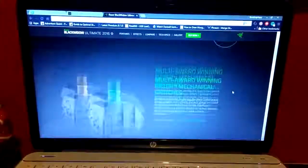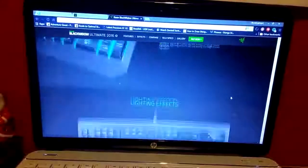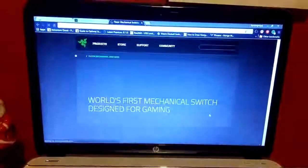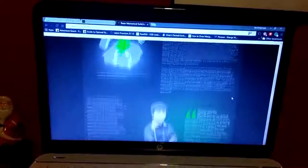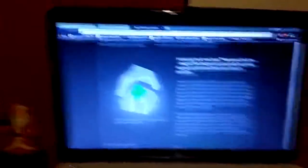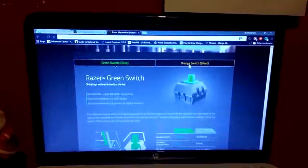A lot of people wanted to know the difference between the two Razer switches. I got the green switch, which is Razer's standard, and there's also the orange switch. The orange is their stealth switch — it's quieter and similar to Cherry MX Red and Black in terms of how the keys function when it comes to noise. If you look at the design, there is a hook on the green switch, whereas the orange switch has a linear stroke so it doesn't catch on the way up and doesn't make the clicking sound.